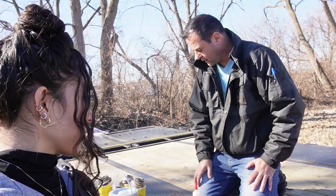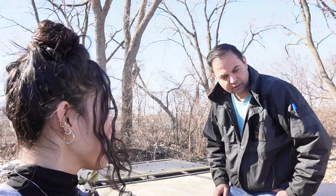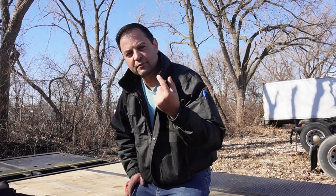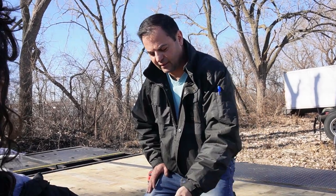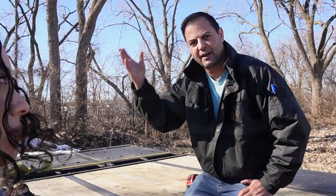That's pretty much it. I think when we do it on the road, I'll probably do another short little video of us doing it just on the road, how easy it is. But that was just changing the caps and changing the oil. Pretty easy. All you gotta do is really know if you need to change the oil, if it's going bad. Color, right? If it's getting dark, change it. Put your finger in there, touch it, smell it. If it smells burnt, a little like a smoke smell to it, change it. It's going bad. I didn't even use half of this, so this is good for another two more changes. So it's not very expensive, and it'll save you a lot of headaches, especially if you lose an axle or something out on the road.